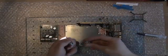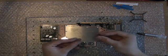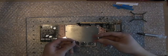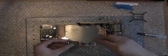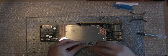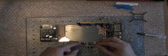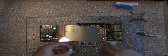As a supplier you get those two blind fittings. Just put them in wherever you want — on top or on the bottom of the card. So you can adjust it just like how your water cooling is set up. But one on each side. Not like this, because then you have no flow — it goes straight through. So keep that in mind.